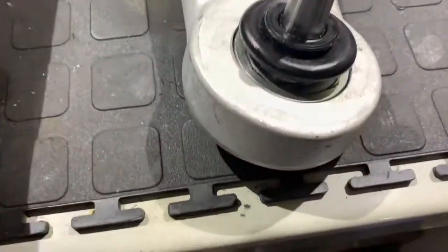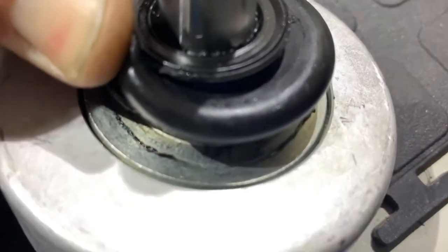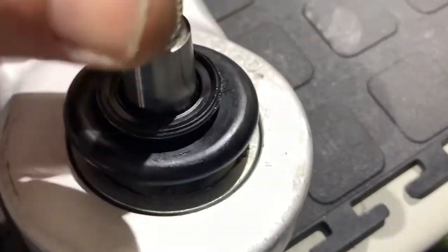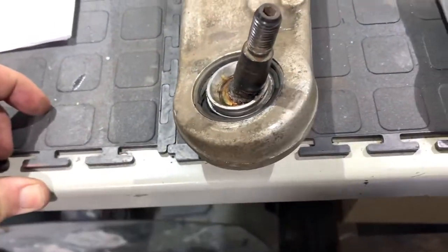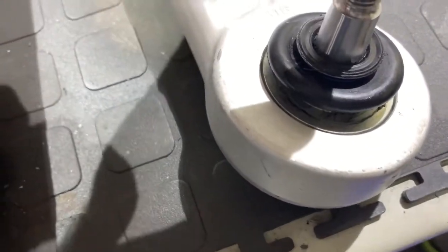I peeled back the little bush and indeed what you see here is there isn't any rubber - this is a metal pressing, a steel pressing inside the aluminium control arm, therefore eliminating that movement. Obviously in a race car we're going to give up a little bit of comfort and smoothness in the interest of stiffness and rigidity, so this suits us down to the ground. But clearly this should also give us some better longevity.